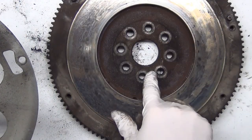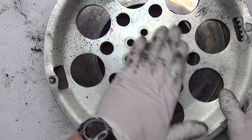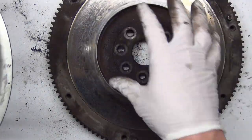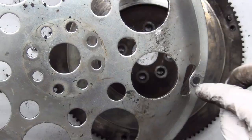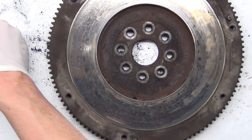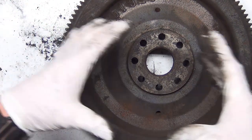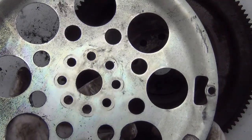You see the bolt pattern here — this is for a Toyota 4Runner 1994, and this is for a 2008 Subaru Legacy Outback. They have a similar bolt pattern; both are an 8-bolt pattern. This flywheel has different bolt holes so that you can put on the pressure plate. The flex plate has just 4 bolt holes — some will have 3, some will have 5 — to bolt on a torque converter. You can see the little circle wear marks. The torque converter will actually have the ring gear on it. You can take these on and off by heating them — they're not welded. You heat this up with a torch and you can pop it off, then heat it to put it back onto the next one. They're just a fit by expansion and contraction. The reason why the flex plate doesn't have to weigh as much is because the torque converter is hefty — it weighs a lot on its own.